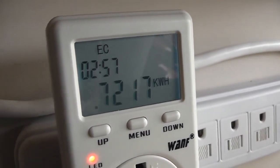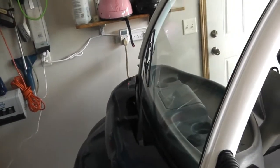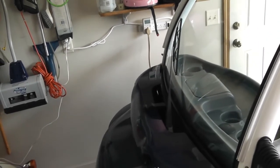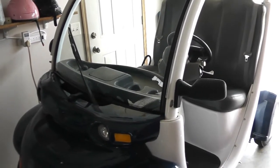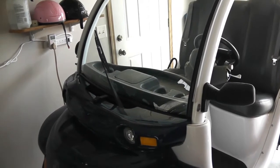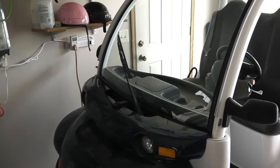20 cents agrees with 1.72 kilowatt-hours at roughly 12 cents per kilowatt-hour. This time I drove approximately 7 miles. Dividing 7 miles into 20 cents, that's a little under 3 cents a mile. I'd probably get slightly better mileage because the battery was cold when I last charged it — when you charge a lead-acid battery when it's cold, the battery doesn't take up as much charge and therefore doesn't deliver as much charge per unit of usage.